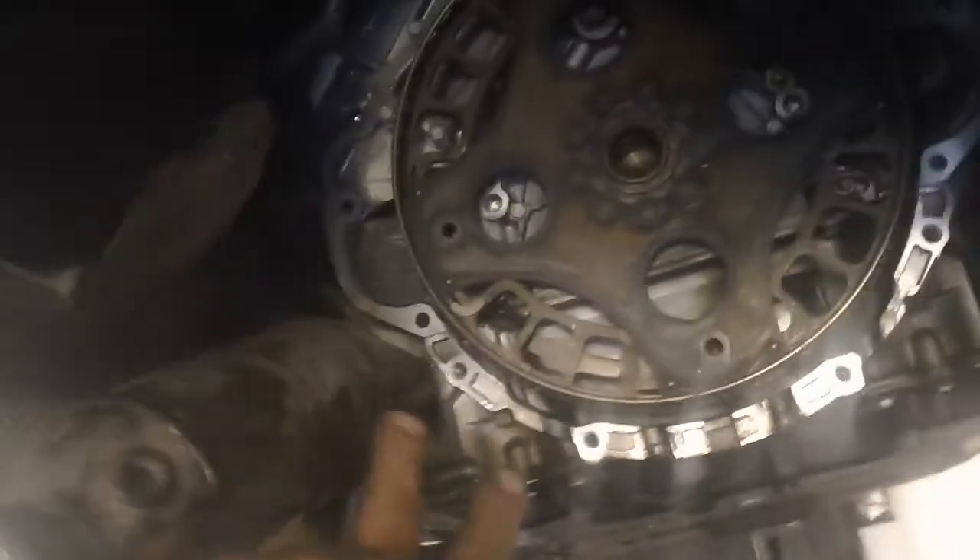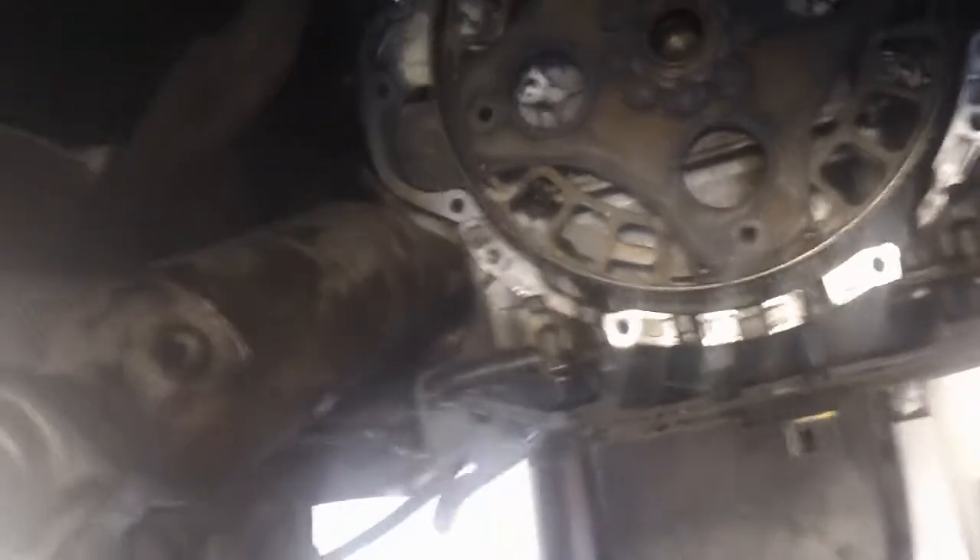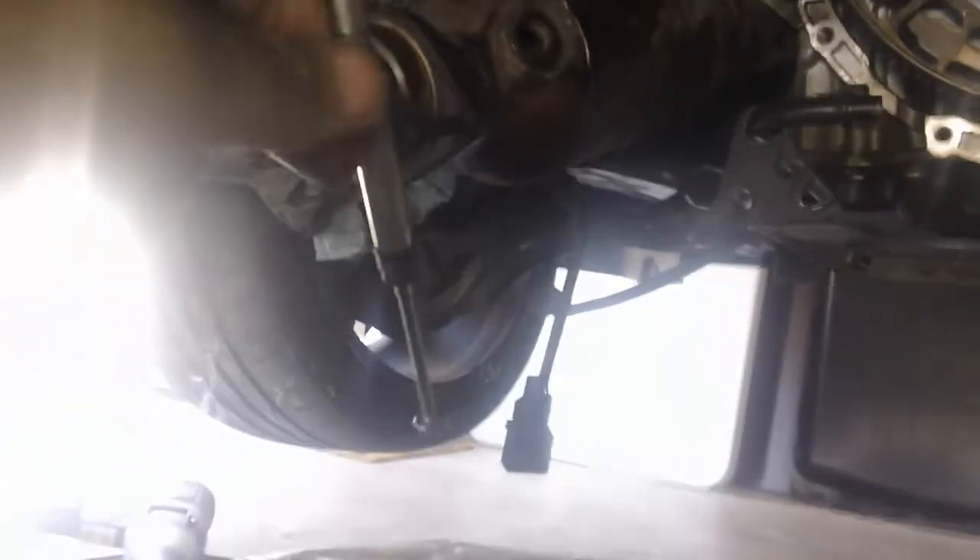You just got to be careful around this line right here — it moves, it's flexible. You undo this for the park brake that bolts on, and then you got those sorted plugs and whatnot. You got one main plug that goes in the back of the transmission, and then you got this little harness thing that plugs into the O2 sensors.